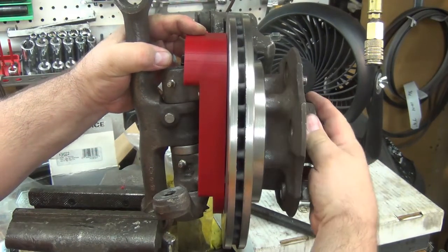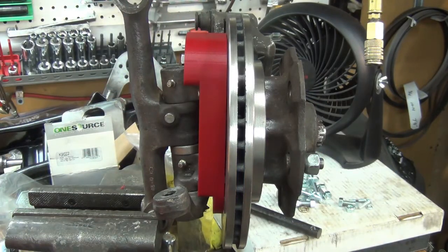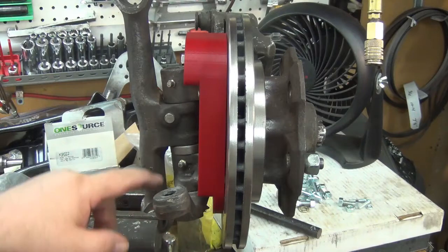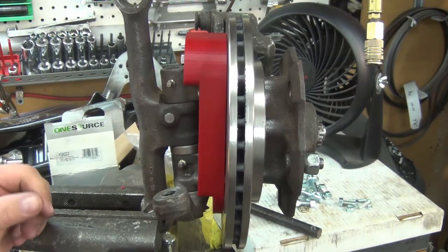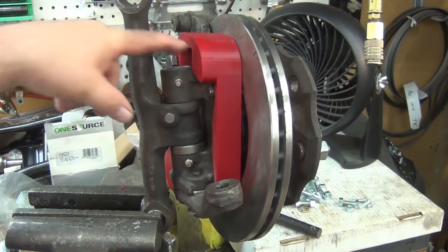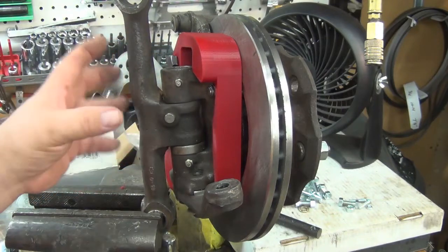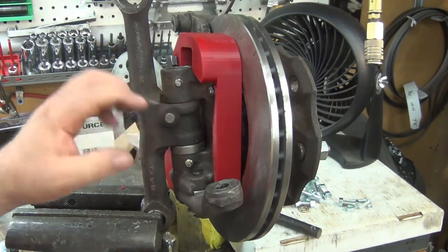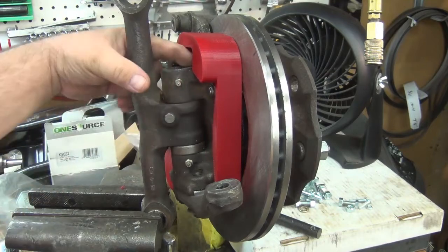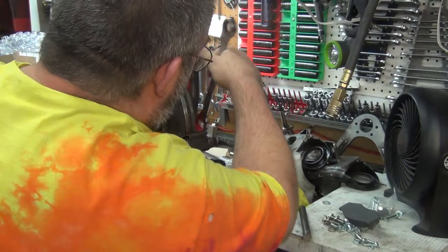After seeing this, I think I'm pretty much ready to make one out of aluminum. My clearance for the steering arm and everything down here is all good. My clearance up top should be enough. I'll have to try this on a 620 spindle because the top part is bigger and has a different angle, so I'll have to check and make sure it still clears in there.